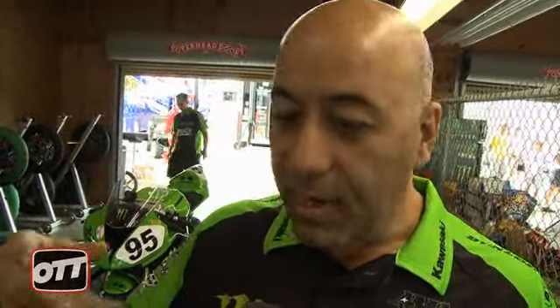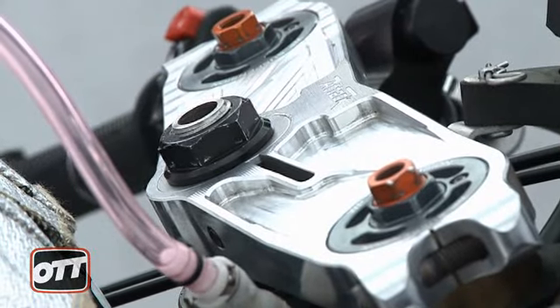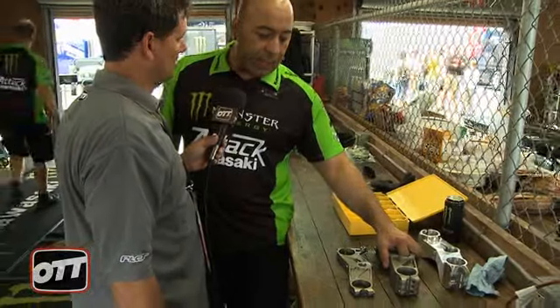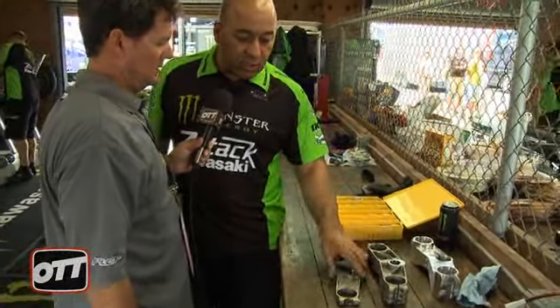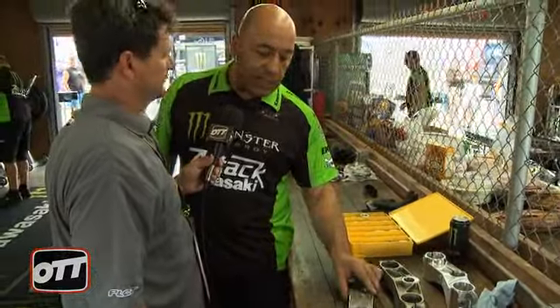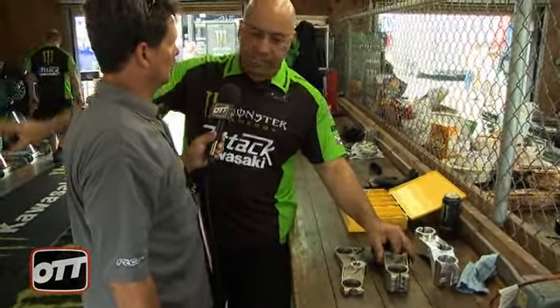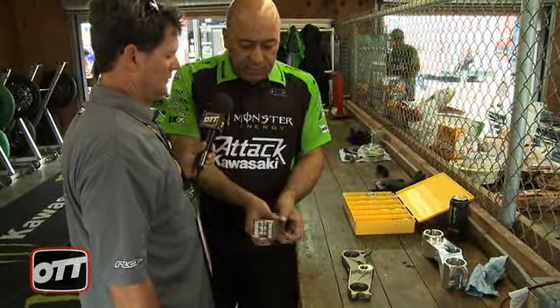You'll find factory teams are constantly changing. If there was a magic trail number, they would design a bike one way and wouldn't need any of this. Ducatis have adjustable steering head and adjustable offset, and so do the Hondas. But with our setup, because we have adjustable inserts like some factory bikes have, we're able to change it without having to change the clamp itself. It makes it very easy because you can leave your stem inside the chassis — you just undo the bolts and pop out your insert.